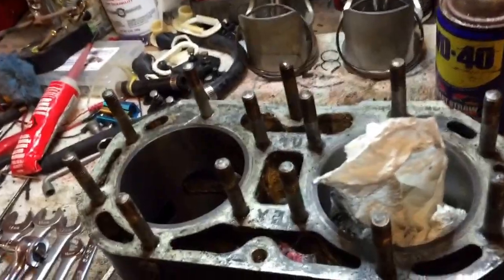Part two — very short. We just got done honing the cylinder and I want to give you guys the final results. I did notice a small scratch like I said in the last video. You can see it here — it does have a light gouge in it. You can't feel anything down below but you could feel a little bit right there — it's probably half a thousandth.